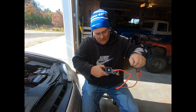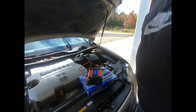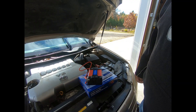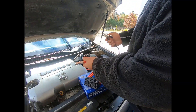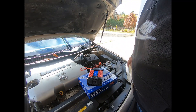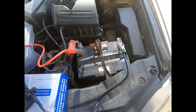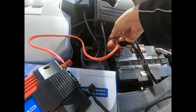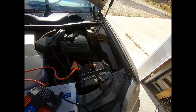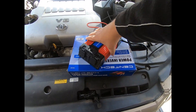Let me reposition and get up closer. This car is a six-cylinder Toyota. I have a bigger vehicle with a bigger battery I could run this on, but the idea was to pick something more common that closely resembles what you have. Positive and negative — all you do is hook them up to the battery studs just like that. That's why you need alligator clips. Do not hook them up backwards. See that plus sign — that means positive. You also have a plus on the battery and a minus on the negative side, so take your time and do that right.